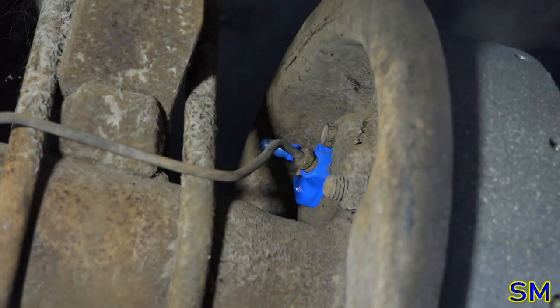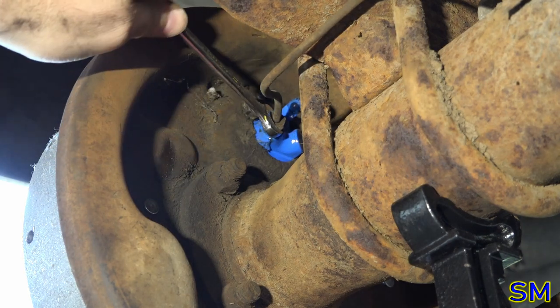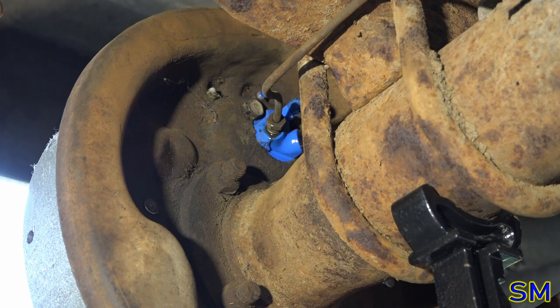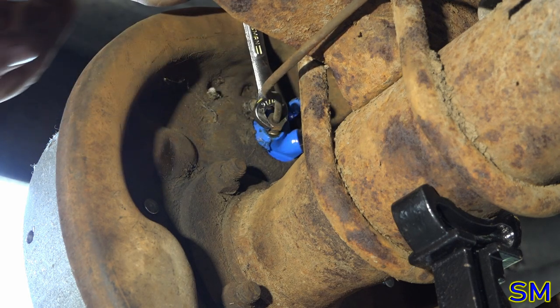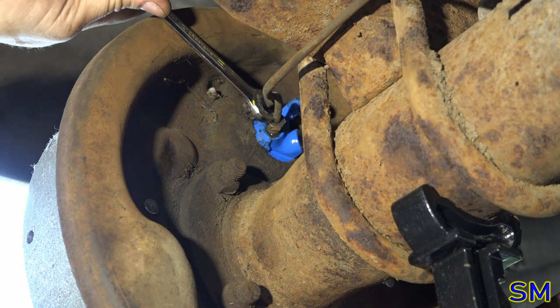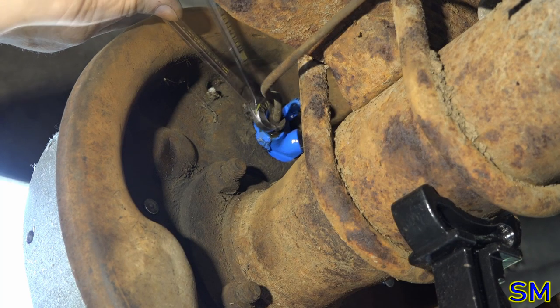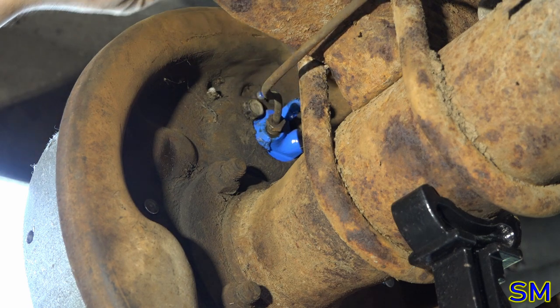Yep, all right. Talk enough for me. Swear air brakes are so much easier to work on. None of this fluid messing about. Air brakes can have their own problems too. Distribution valves freezing up. Relays going bad. This will work fine for our application.